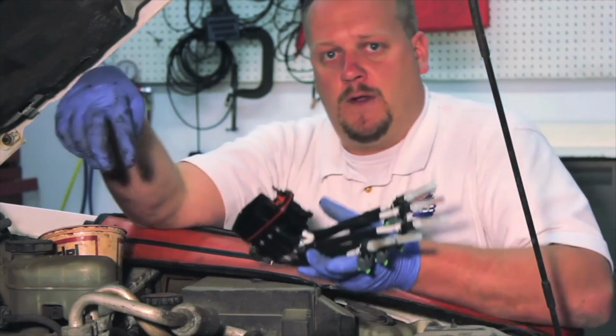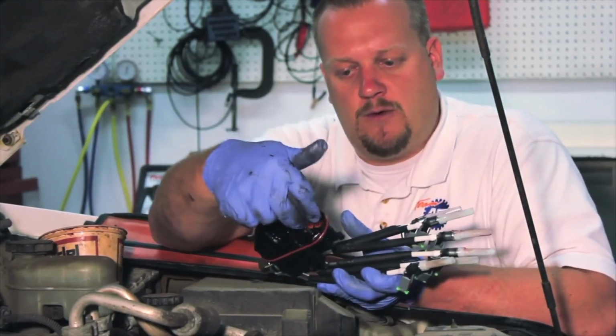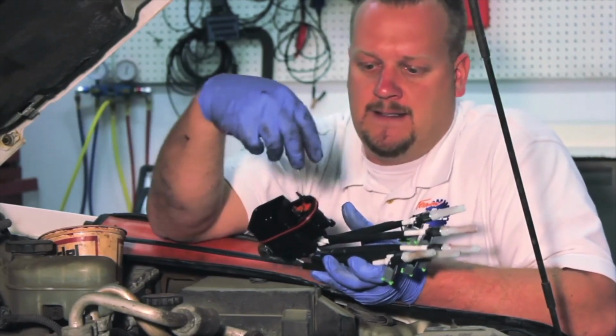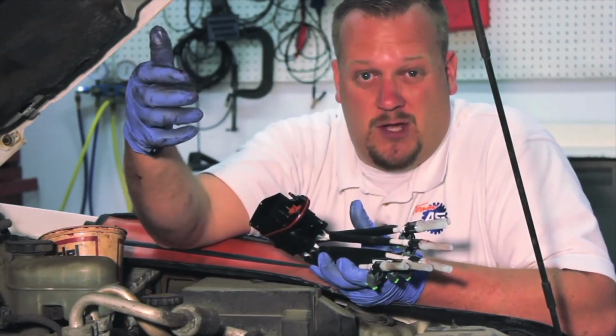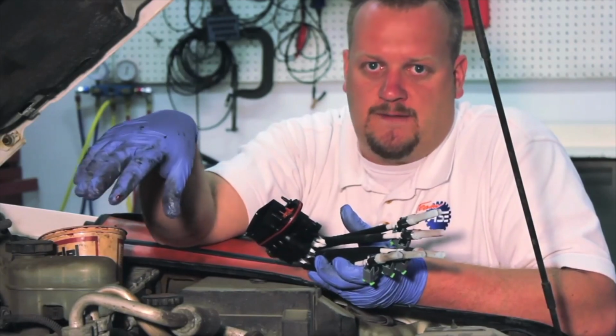Also, the fuel lines where they come from the tank are going to come in the top here. And so once I remove these caps, once everything's installed, I'm going to lubricate these steel lines because we've got a couple of O-rings inside here. We don't want those rolling over, getting pinched off either. So lubrication is the key here to a successful installation.